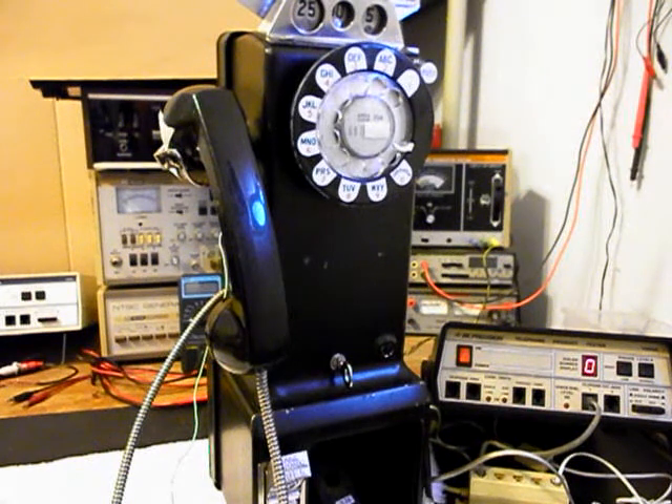Now, we also went through the rotary — that was cleaned, oiled, and adjusted. We went through the hook switch. We went through the bell and bell circuit — that had to be repaired. We rewired this unit the way we wanted it wired to work the way we wanted it to work. We also installed a modular line port so that you can simply walk up to this payphone, plug in any length line cord, any color that you choose. It makes for a simple, easy plug-and-play connection.